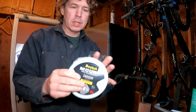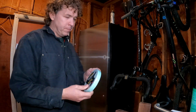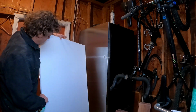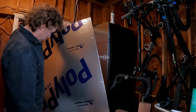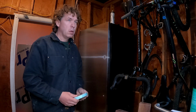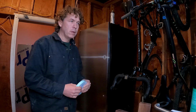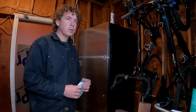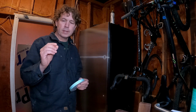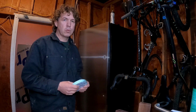All right, I picked up some of this foam tape. I thought I had some sitting around, couldn't find it. So the insulation says, of course not on this particular piece, but on the piece of foam, that it was R1.98, so not very good for what I have. Or maybe it was, no, this is the 3/4, so it was like R2 something or other. And then if you had the 1/8 inch air gap, then it was like 3 something, I think.